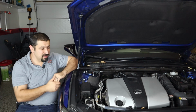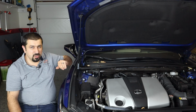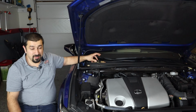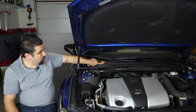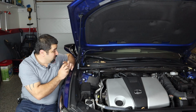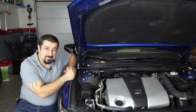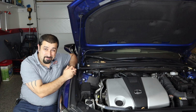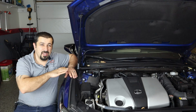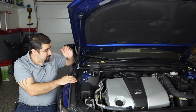These leaves sit here and usually they crumple up if you open the hood, close it. As you drive, they're dry, they'll start crumpling up. You notice there are openings on the cowl right here. On every cowl, on every car, you'll see those openings. You want to guess what's right underneath that opening? The cabin filter. Specifically, when you have your air conditioning on fresh air, this is where it's going to take the fresh air from.